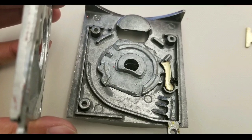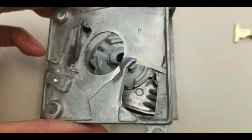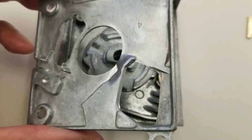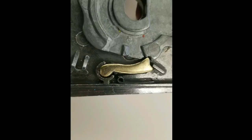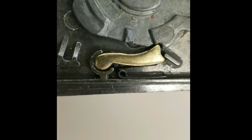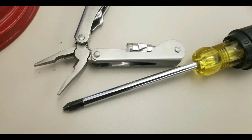If you take off the back piece, just watch out for that spring, because that brass piece actually locks things into place. It's really, really cool — it's very simple in design. It basically has a latch, and the latch closes after every turn. The coin goes in the center and basically allows it to keep on going. Watch out for that spring — you don't want to lose that. But in case you do, that's how it looks.